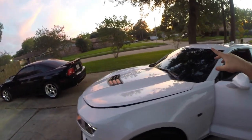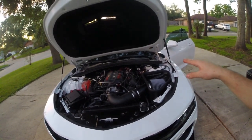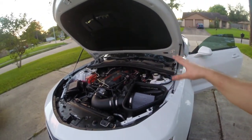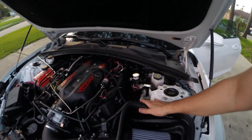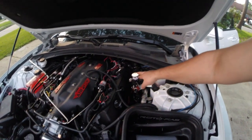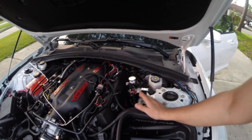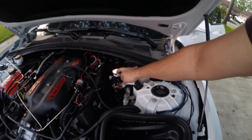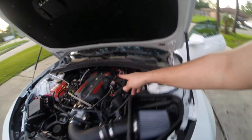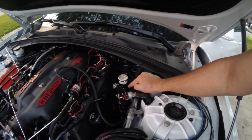That thing felt really nice, but the logs showed it at almost 12.8 AFR, which is basically the same as the car runs with the nitrous off - that's not good. We really don't want to run bigger shots at 12.8; we want it down in the 11.8 to 12.0 range. The issue is likely our fuel pressure - once the nitrous actually flows fuel and you have flow, the running flowing pressure is going to be a lot different. When I was draining the tank with the line completely open and no back pressure, it was almost at zero PSI.